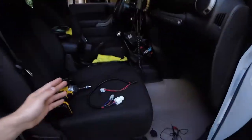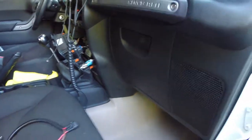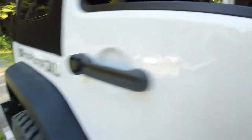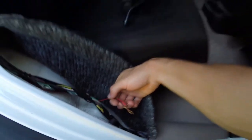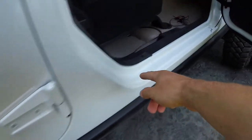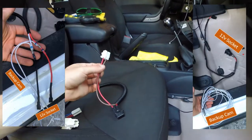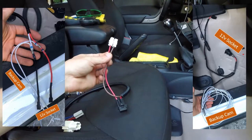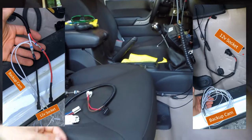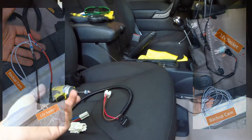I initially was trying to add power back there, but I still don't have power, so I came up with another solution. This adapter does work plugging off of the 12 volt outlet here in the center dash, so I'm going to tap into that. I already started running the power for the camera down the line, but I ran out of cable right about here. I just have to extend this a little bit further, route that along the kick panel, bring it up, and then do a simple splice — I'll put on a 12 volt socket and also splice in a tee off of it to make a connector for the reverse camera.